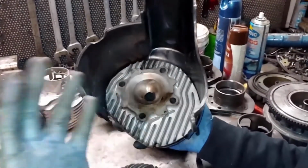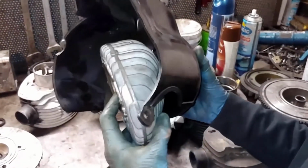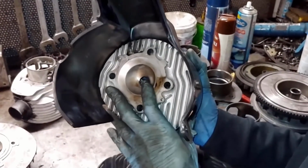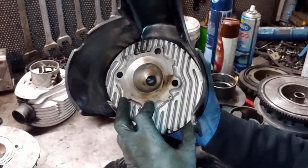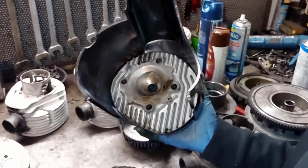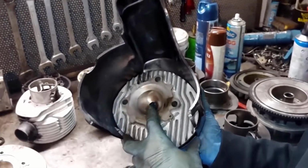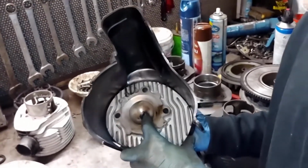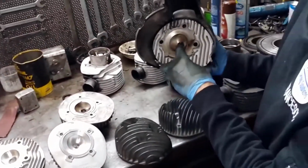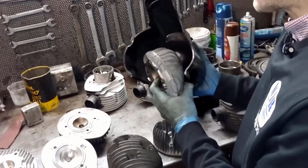It originally has that of the 200, which is already an upgrade that doesn't have much horsepower. And when it's modified, elaborations are made, and even only with valve intake, so 221, a little pushed, you can get very well to 25 horsepower. In these conditions, cooling becomes critical, despite the aluminium cylinder. But the head is always the same. The radiant surface of the head can vary little.